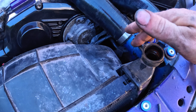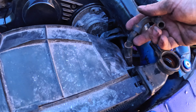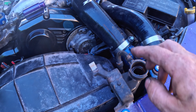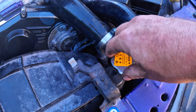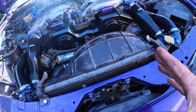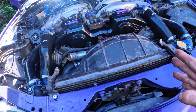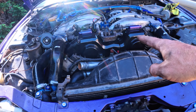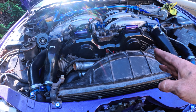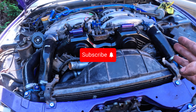Spot the deliberate mistake - the fitting that goes on there was stuck down at the bottom, so take two: the rad is back in, this time with the bracket tucked in properly, brackets back on, and the rad cap back in. Now this is ready for several flushes with distilled water to make sure there's no more rubbish in it, then I'll top up the coolant. Because I need to leave 24 hours for the RTV to cure, I'll actually leave it 48 hours to be safe - and I'll cover the coolant fill in a separate video. Thanks for watching!